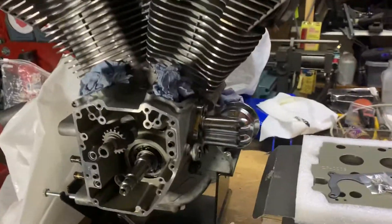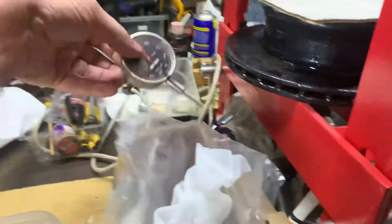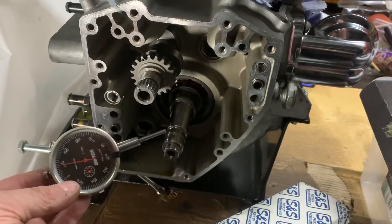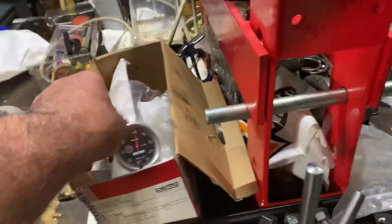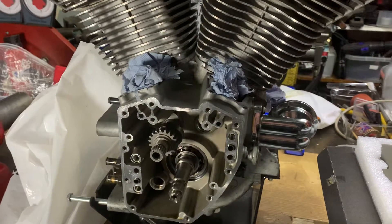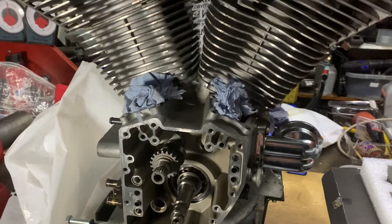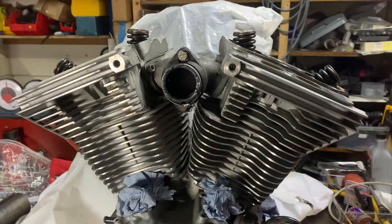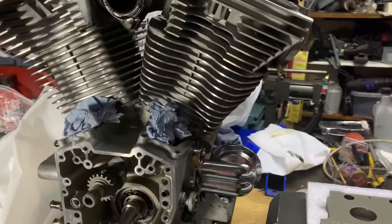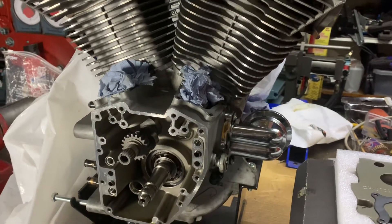All you must do is check your crank run out. You'll get a clock — a dial indicator — you'll put it on your crank and check the run out. If the run out is over half a thou, it's not a good idea. Some of the new bikes, 07-up, can be up to 15 thou out. With all these old bikes up to 02, generally the cranks are bang on, and they still have the Timken taper roller in the back side on the sprocket shaft side.